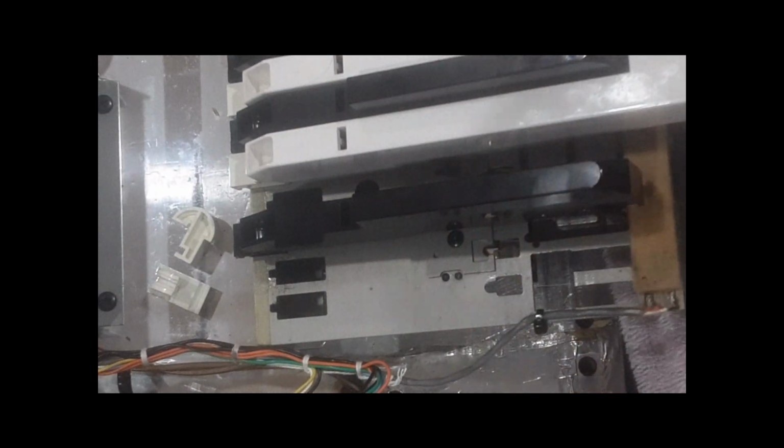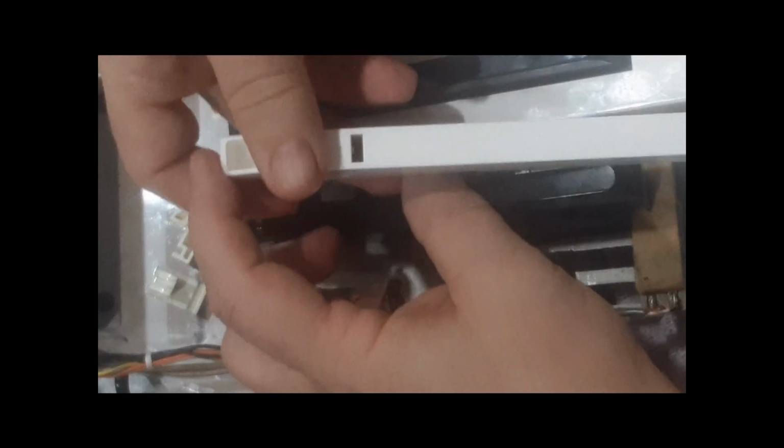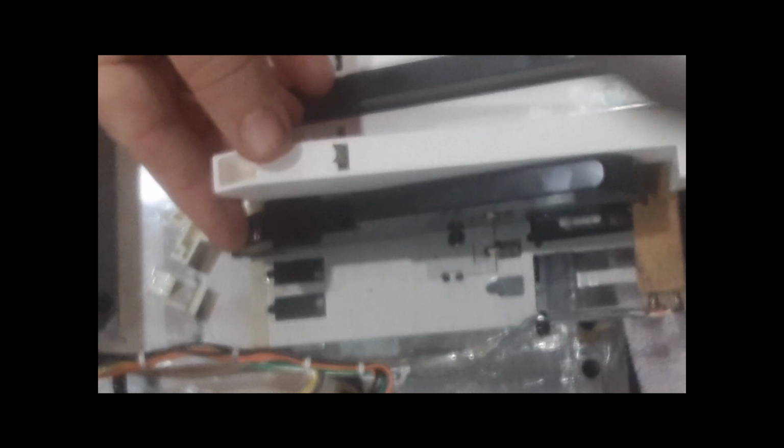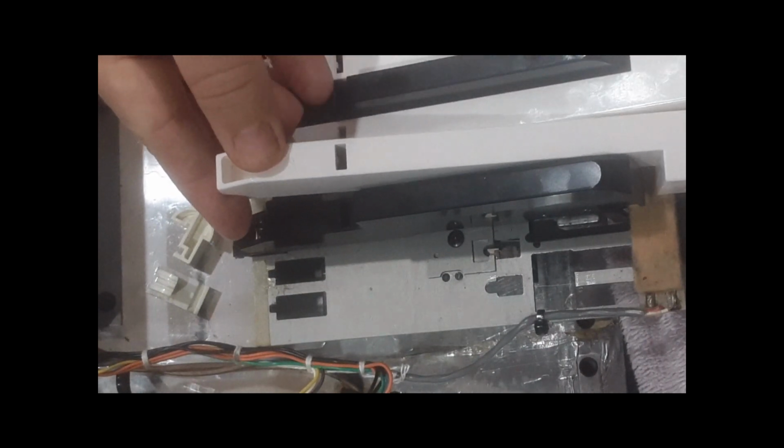Now it's a little more difficult because we got to get this white key in now. The way I find it is I kind of get the key, the spring, at almost like a high angle like that. And then I hook this end down here on the key. I get that in, and then I get the spring, carefully watching the spring, go into the channel. You see what happens? My spring popped up over here. Okay, so I barely saw it pop into the channel.